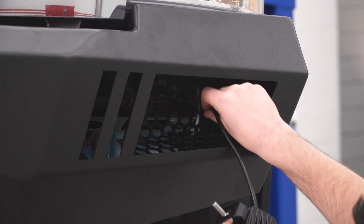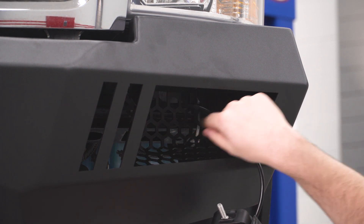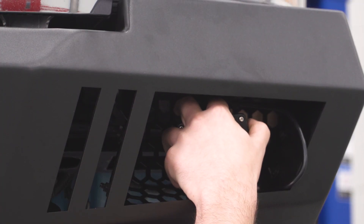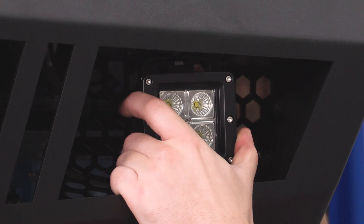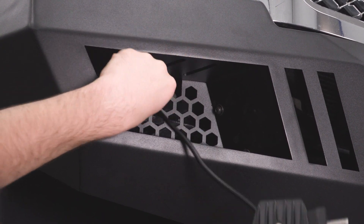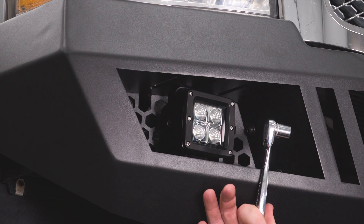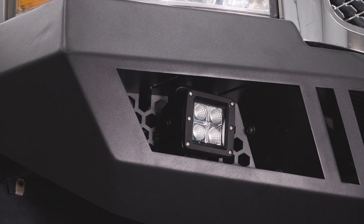We're gonna push through our connector first, and then we have three choices for where we want this to be. If you have four pod lights, you could put one on either side; however, the kit only comes with two, so we're gonna go right for the middle. Then on the other side — just throw it on that lock washer, then a 13-millimeter nut. And then we're gonna come over here and do the same thing on the other side. To tighten this down, I'm using a 13-millimeter socket on the ratchet. It is a tight space up there though — if you have a ratcheting wrench, that would probably be the best way to get that nut.